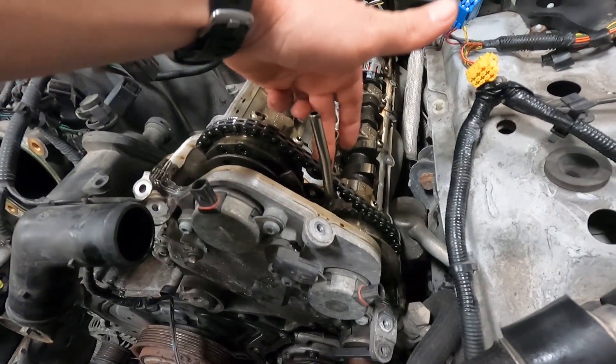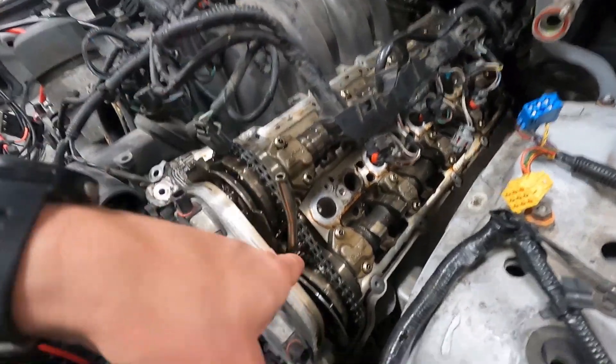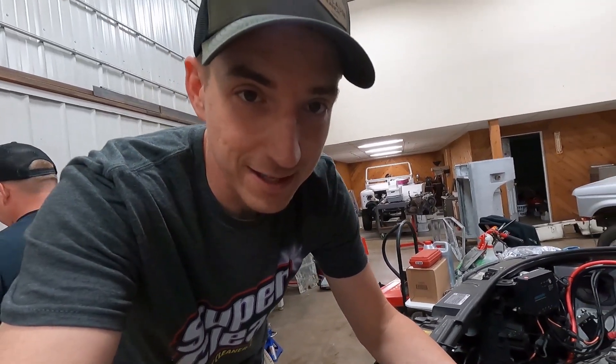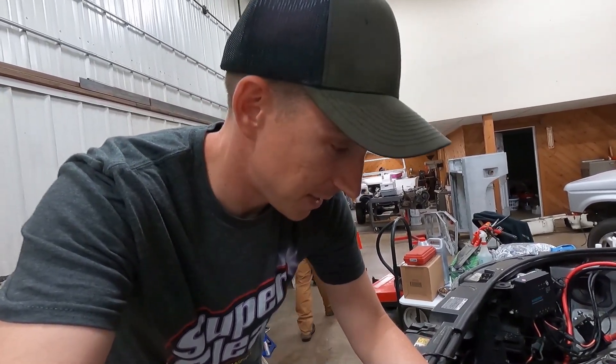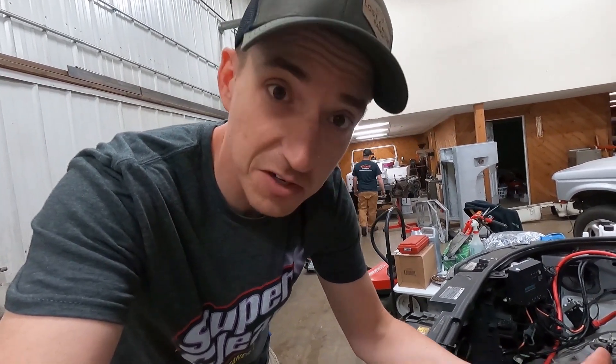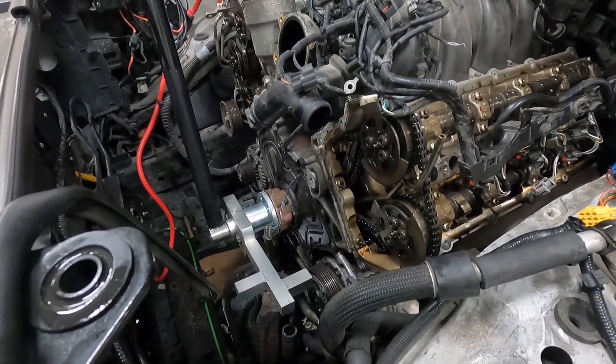She's a little loose — someone's already been in here. We've got marks on all the timing stuff, and this thing's only got 90,000 miles so it couldn't have been that long ago. Whoever did whatever they did last time didn't do it correctly, so we get to do it again. We've got this fun contraption to get the really tight crank bolt out.